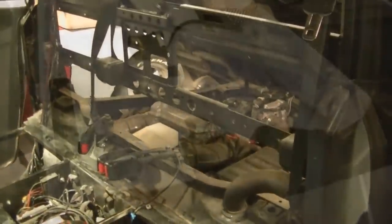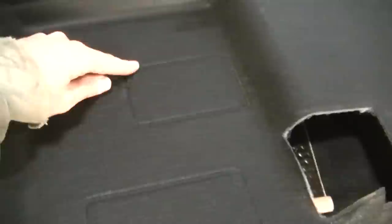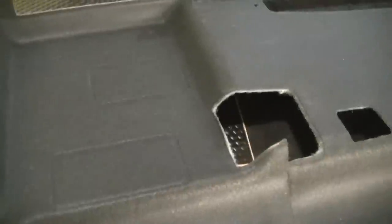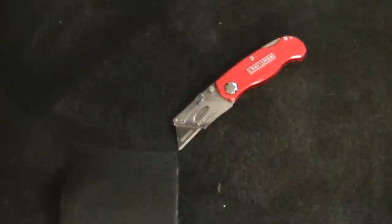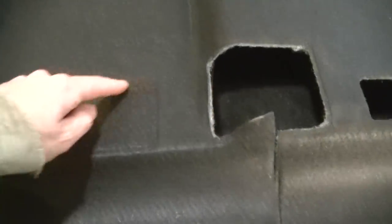I'm test fitting this back carpet panel and you're gonna have to cut a few areas out. I already cut the area for the seat belt, and there are two more areas marked on the back for the seat to go through - so I've got to cut those out. Why they don't have them stamped out to begin with I have no idea. I'm using a razor and sharp scissors to do this but it's not that easy - this stuff is pretty thick. Pretty annoyed that they didn't just cut these holes out themselves.